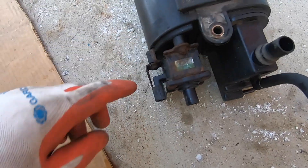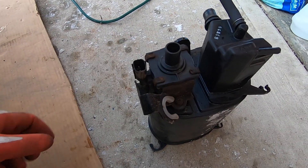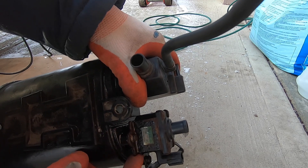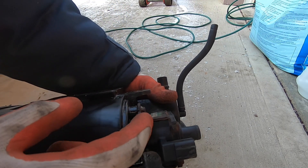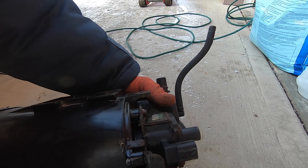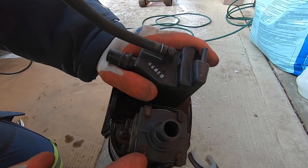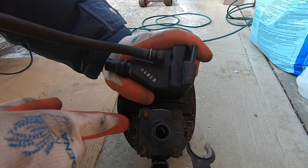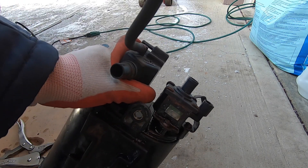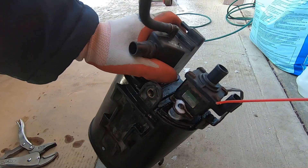This particular part is where the problem lies — this is the vent purge solenoid, and it's a very common failure point on this Honda and in fact a lot of Hondas. The reason it fails is there's a plastic body sandwiched inside a metal bracket. On this car with 330,000 kilometers there's a lot of corrosion forming on the bracket, and as it rusts it makes the seal between the plastic joints fail, so it doesn't hold vacuum or tank pressure. When you order a new one from Honda they're about $120. I strongly encourage you to also order replacement screws — two Phillips screws hold the solenoid and a third holds the hose bracket. With this much rust, use something like Liquid Wrench penetrating lube and soak these bolts down.